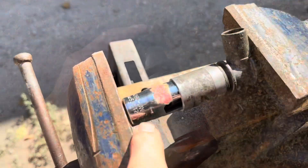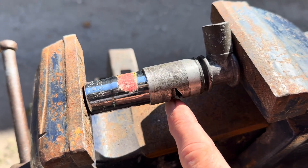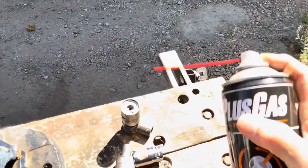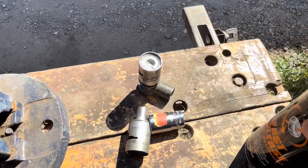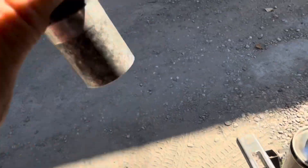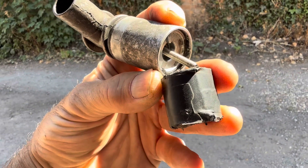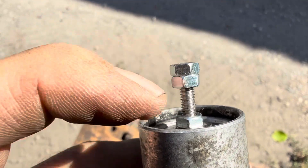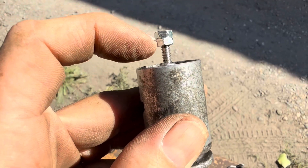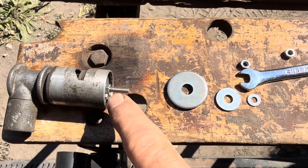Next up we're going to have a go at getting the stuck piston out of this housing. I've got a 7/16th socket and I'm just moving this piston up slightly just to break the rust, and then we'll put some penetrating oil in there. We don't want to move it too far, otherwise we'll never get it back down again. But once we've broken the main seal, often these things will release. We're going to use a little bit of Plus Gas in here, get it all around the edges and also down on this edge here. We're going to drop a bolt through this hole here and try and get it to come out of that hole there. A little trick is to use a neodymium magnet — that bolt will find its way through that hole without any issues. It's just using a series of washers and a spring washer in there and two of these nuts locked together. We've managed to tighten that down, so this is now really tight. What we're actually going to do is use a series of washers and then see if we can wind one of these nuts down to pull it out — just use a big washer over the end and then these two small washers and then see if we can tighten one of these nuts to wind that piston out.